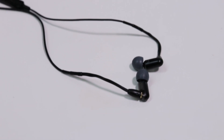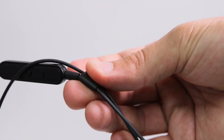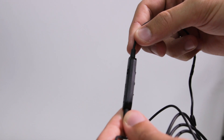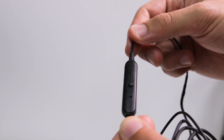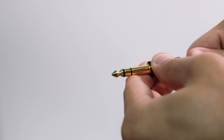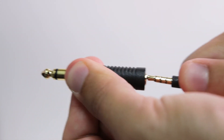Apart from those factors, otherwise the build of the AONIQ 3 is that of your standard wired earphone. The cable features a plastic portion you can adjust to keep your excess out of the way, and the MMCX cable connection supports a three button control panel to pause, play, or adjust volume. Considering Shure's history in building microphones, it should come as no surprise that the built-in mic is good quality and call quality is solid. Each earpiece comes with a single balanced armature driver in a protective frame within the housing. It's curious that these come with a quarter inch extension given their low resistance of just 28 ohms, but it will keep amp users happy. You can also easily convert these to true wireless earbuds by connecting to the separately available Secure Fit wireless adapter or any other MMCX cable accessories, which is a big plus for customization.